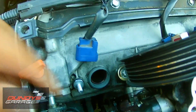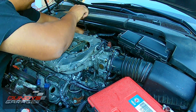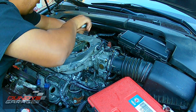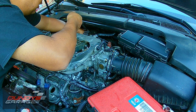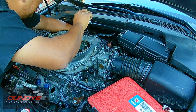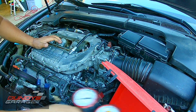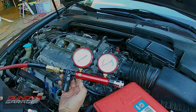It's a good idea to go ahead and take out all the spark plugs, which I've done on this vehicle. Also lock the engine into place because when I did it, it wanted to rotate on me. Lead the hose down onto the backside of cylinder number two. You're going to want to screw this thing all the way in — don't overtighten it, but don't leave it loose either, just snug it up. The reason is you don't want air escaping out through the spark plug tube. I'm turning this with my right hand and guiding it down with my left.